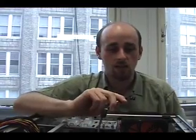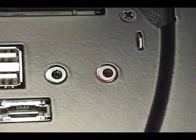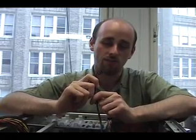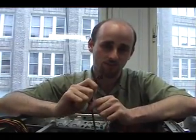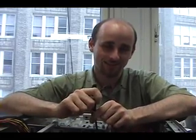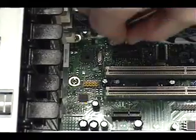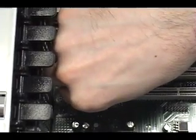This is our Azalea audio connector, which will give us access to our headphones and microphone jack at the top of the computer. This is a high-definition audio cable, and you need to be very careful that you plug it into the right place, because if you don't, problems can result. Trust me on this — I've seen it firsthand. It's not pretty. Here's how to do it the right way: we're going to plug the connector into the yellow header here, like so.